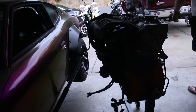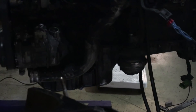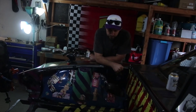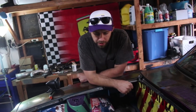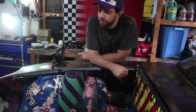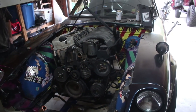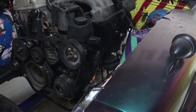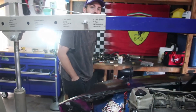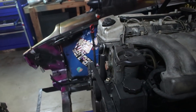What did the Richmond weigh in at? We don't know because we never separated them. So for science, we're going to drop the OM606 in there and see how it looks. Sam was pointing out that the sump is on the wrong side, but that's okay — it's a front sump, these things have front steering so it's not going to sit all the way down. We've made sump changes in the past — we made a dry sump pan for the 13B on the Beetle that worked just fine, so we can make a normal oil pan and pick up. The only reason it's sitting this high is because the sump is in the wrong spot. It's got plenty of room, it's going to fit great.